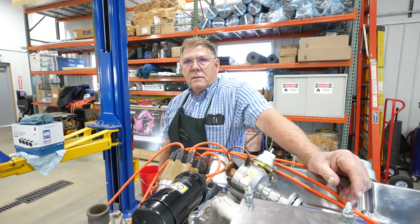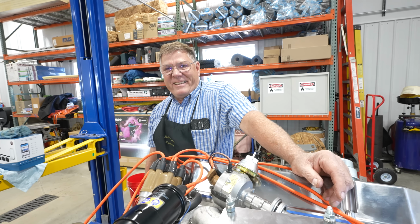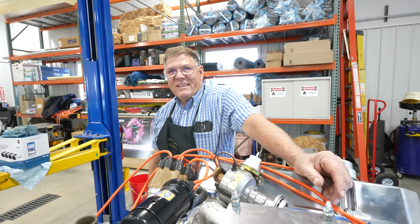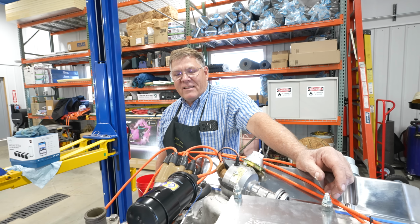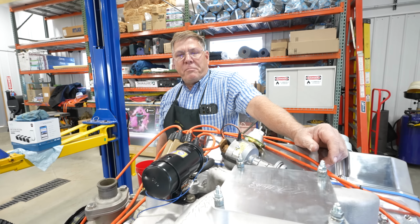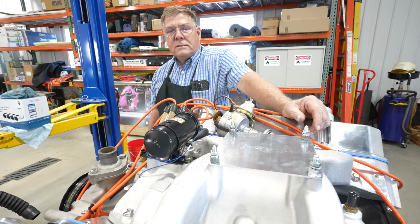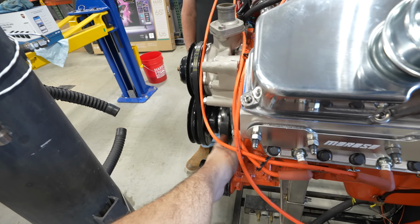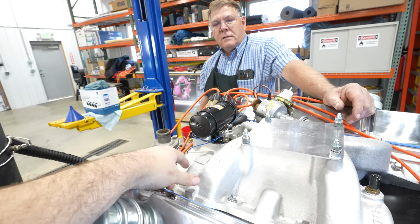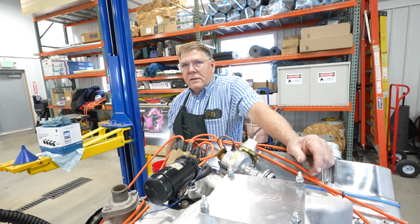We had left his original distributor there. This is the day before Thanksgiving, so we can't buy anything. We're just screwed. And our only other day to finish up on the dyno is the day after Thanksgiving, which we had hoped we wouldn't need the second day anyway, but that's what happened. Kept that in the back of our mind. So we come home, and sure enough, we get the original intermediate shaft from when this was a 413. And you compare it against the tang on the distributor, and it's like, what the heck? That's definitely where our backlash is.